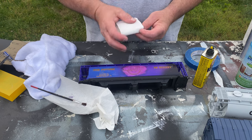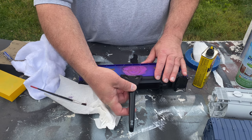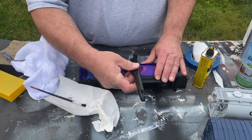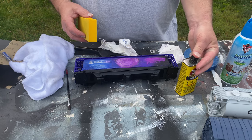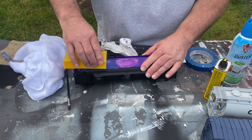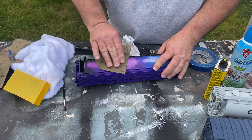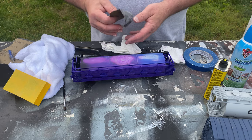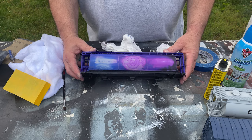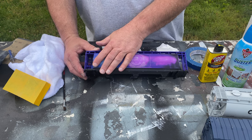A little bit of the edges is stubborn, so let's coax it off very carefully with a little window scraper — really just a blade. That seems to be working pretty well. Now we're going to smooth it out, starting with some 320 grit sanding block, next with some 600 grit sandpaper, and finally some 1,500 grit sandpaper. It's almost ready to paint. But before we tape it off, we're going to wash it off with a little soap and water to make sure we got all the Goof Off off, since any residue is going to prevent the paint from adhering.